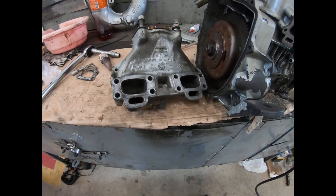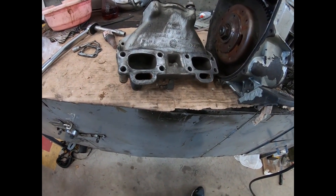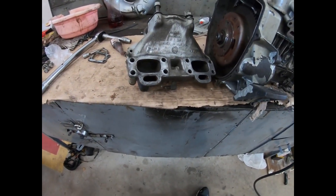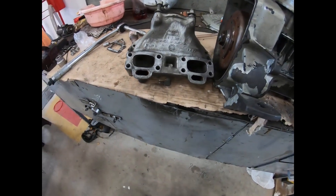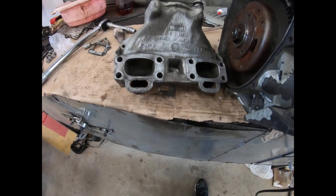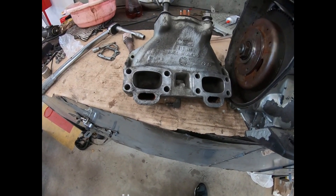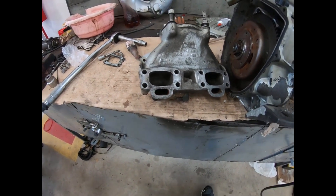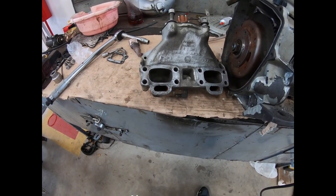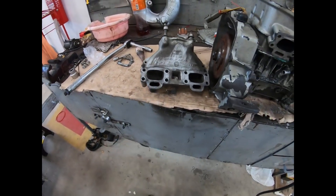This nipple distributes the water to two different hoses: one of them is the telltale of the jet ski, and the other goes to the back of the exhaust, which is done to reduce the amount of smoke that comes out. On another video, I'm already going to have my engine installed in my jet ski and I'm going to record and show where each hose goes — what hose pulls it out of the jet pump, what hose goes back, what hose goes into the exhaust — because I couldn't find any video on YouTube that would show how each hose connects. If this video helped you, don't forget to subscribe. See you later.